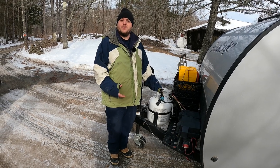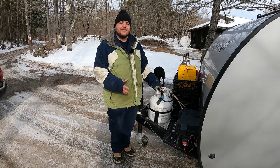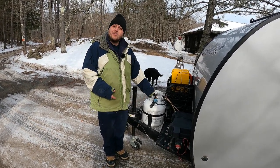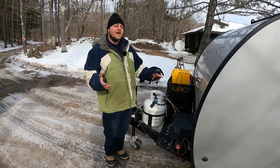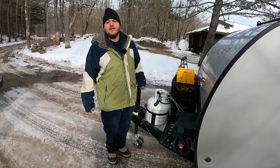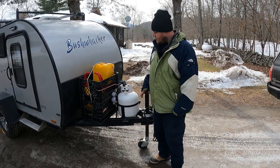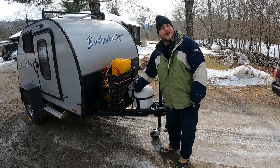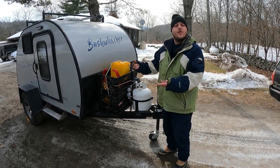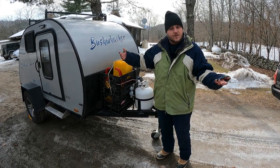It doesn't matter what system we're working on, whether it's on a camper or not — having a good grasp of the fundamentals is far superior than just a list of tips and tricks. The propane system on a camper is relatively simple, but there's a few things about it that could be really helpful if we understand them better. The components of an RV propane system are all pretty similar: a tank, a regulator, a distribution system, pipes or rubber hoses, and that goes to point of use — where you'll find a propane appliance like a furnace or a stove.